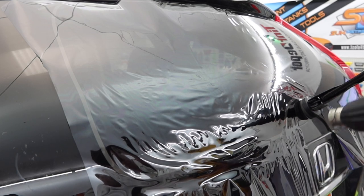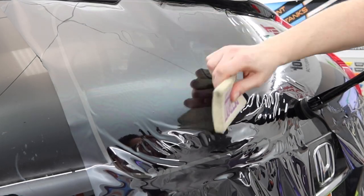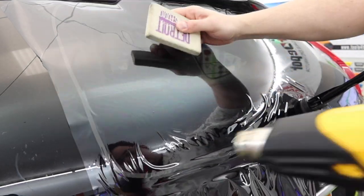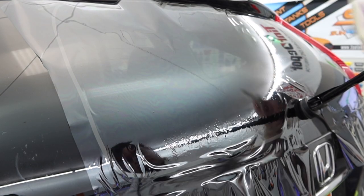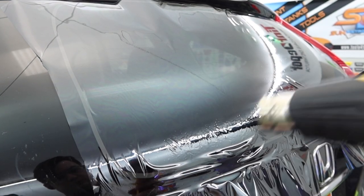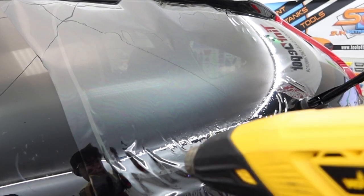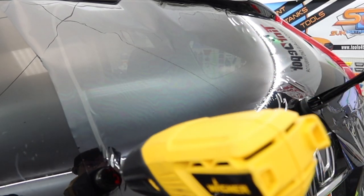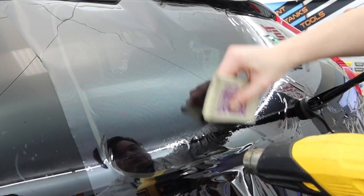You can even overheat the bottom and get that curve. We're going to organize it with the felt card — push all that air out and see how the film wants to lay down. See that lower left-hand corner? There's still a decent air pocket there, and also a little bit of dirt left over from the wiper blade in that spot, so it looks a little messy. Put a little bit more heat there and it lays right down. It's also not unusual to have some slight air pockets from the glass edge — so don't be alarmed by that at all.